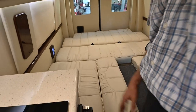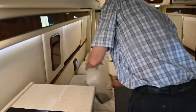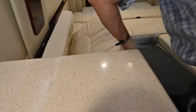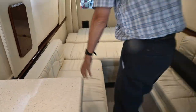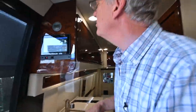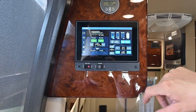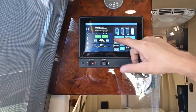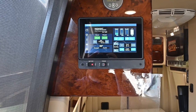I can put my cushions on each side to fill up that space and make this one big king sleeping area. You have the option of doing a big king bed or sleeping on the two side ones if you need to, and still have room to hop off in the middle to go to the restroom at night. The fresh water is at 33% now. We also have tank heaters — in winter, you can turn those on and there are heating pads on the bottom of those tanks (fresh, black, and gray). At about 40 degrees they'll come on and keep those thawed out.